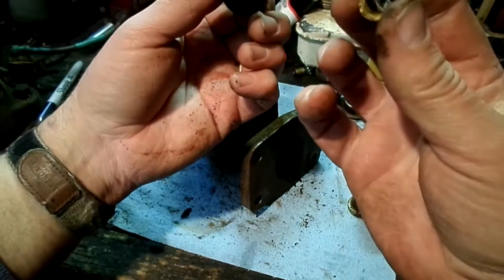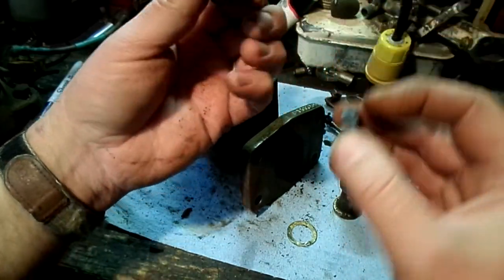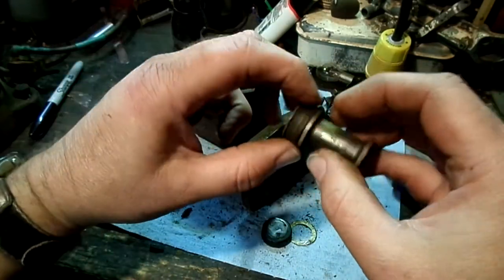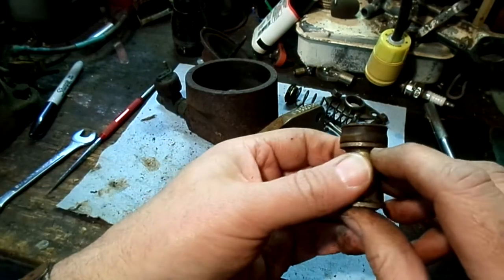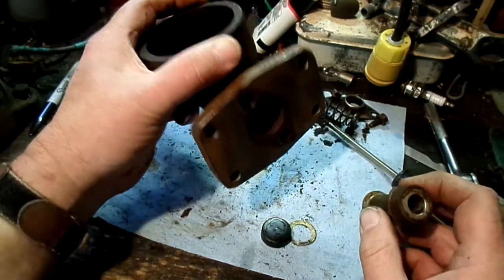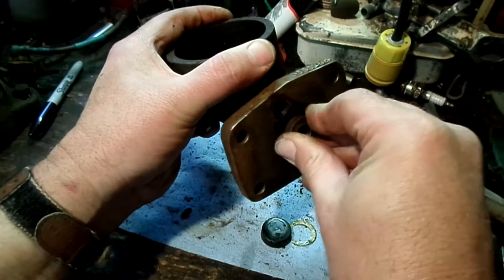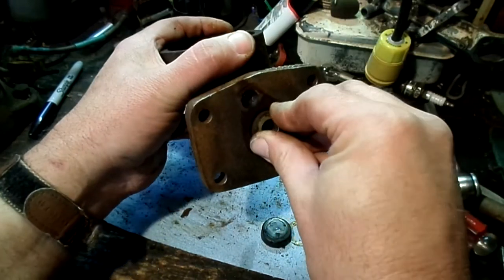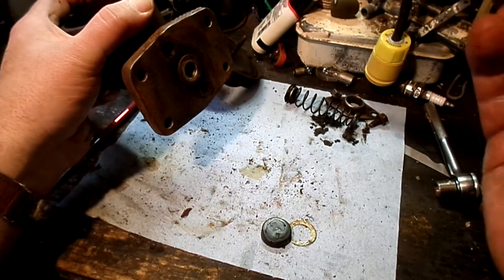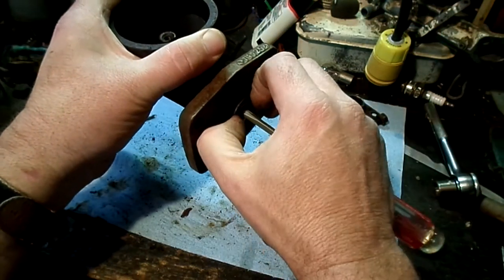There's a little brass washer that goes between the piston and the cup seal. You can also see it's tinted from where it had rusted to the master cylinder — when I first started reworking this thing it was stuck big time. I kind of had to hammer on the pedal to get it to move and it broke loose. All there is is a rod that comes from the brake pedal assembly, goes into the back of this, and that's what operates the system.